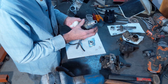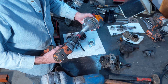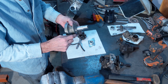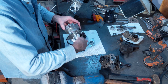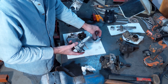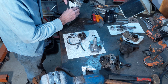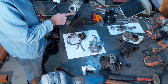As you can see, it left a pretty rough finish — you can see some of the streaks there — so I just took sandpaper and cleaned it all up. There's an O-ring that goes on here and sits inside the Z22 pedestal — slides up on there. Besides these modifications, I'm also going to have to redrill the pedestal holes because they don't line up anymore. The Z22 pattern is different than the KA24E pattern.